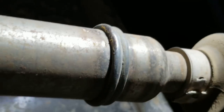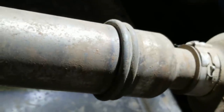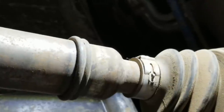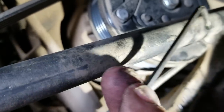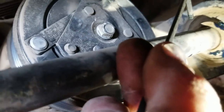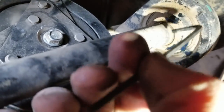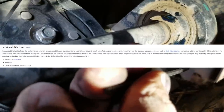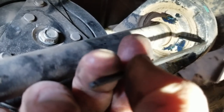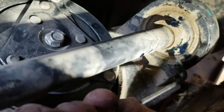This is interesting - look at the shaft. That's a friction weld. They hold one piece and spin the other piece real fast, then jam them together and it welds up. There's probably a John Deere engine nerd in the comments who'll tell you more. This bearing is too small - not because it can't handle the torque, but for serviceability. There's too much flexion going on and it's not staying put. You'd need to make this bearing about four times the size in the next revision to get real meat on there. It's only got 300 hours on it and it's already failing - not good.